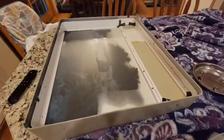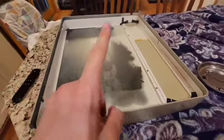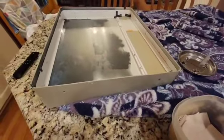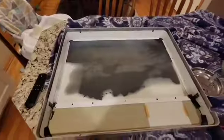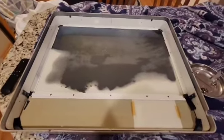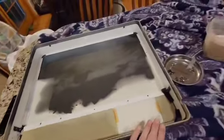I already took a screw out, but basically, once you get to this part, there's going to be eight screws going around the whole perimeter. So you have two right here and on each other side — I'm going to take those out. Next step: you should have four black Phillips screws right there. Nothing should be in the center, so that would be the next step to take those four out. We took those four out, took the eight around the perimeter out, now we can flip this upside down and the plastic outer case — which is this gray piece — should come out.